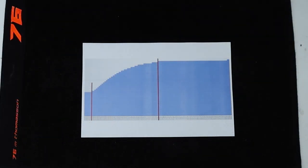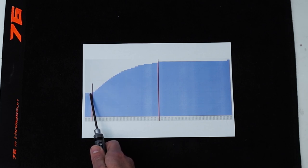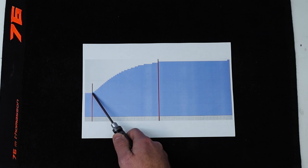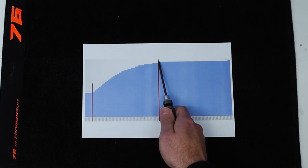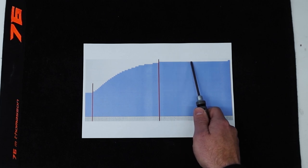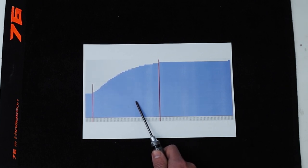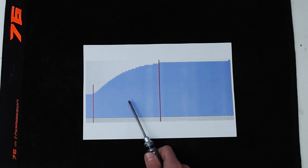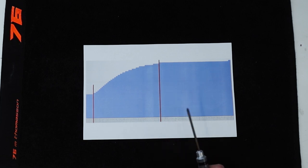Right, here it is. This is the data straight out of the 7PX telemetry system. I imported this stuff into Excel and then just did a quick graph for you guys. So you can see here, the first red line is at start at ambient temperature, so just under 18 degrees. And then after about a minute and a half, we reach just over 40 degrees Celsius here. So you can see here at this point, we get a good heat soak. And then the temperature levels out until I begin to rev the engine harder. So here, I was only revving to around 40%. So that's 40% throttle for a minute and a half in pulses to get us to that heat soak point where both the piston and cylinder are at a really good temperature to start running.